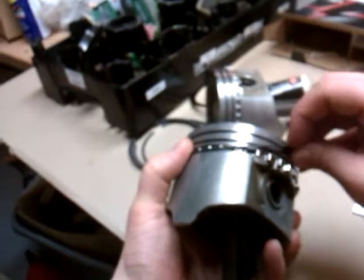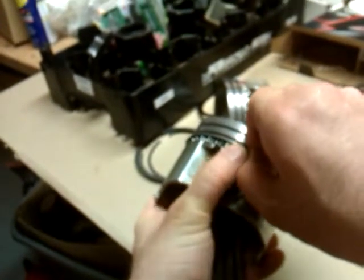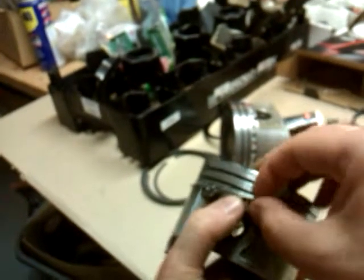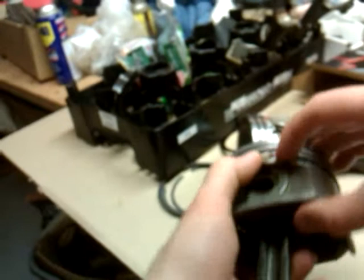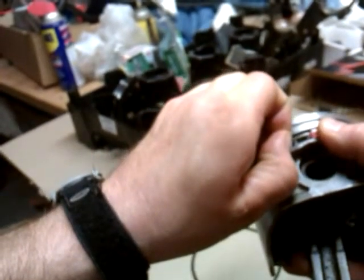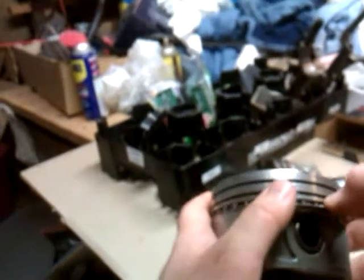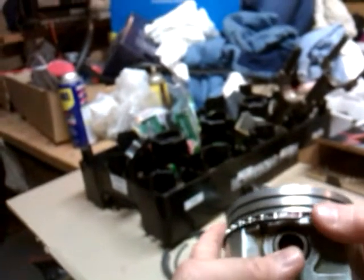Be careful not to snap the ring — you can break a ring just being careless. Pick this up over this side. These two are not butted. We'll get this around here. It's in there. Now it's on the bottom. Separate these and set them where they go. Line them up with the boss. They are free floating and it's in there.